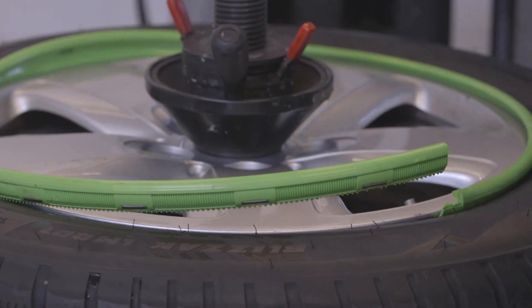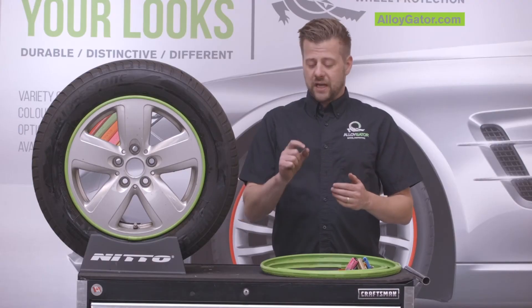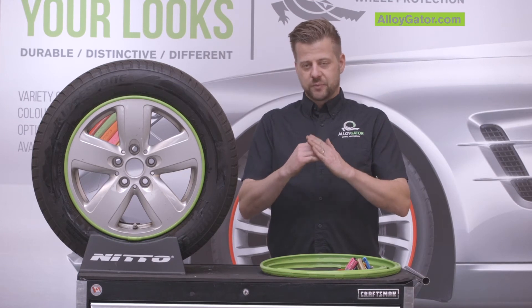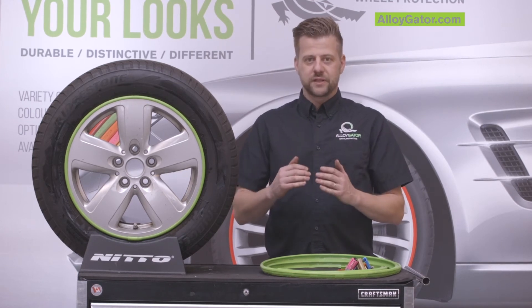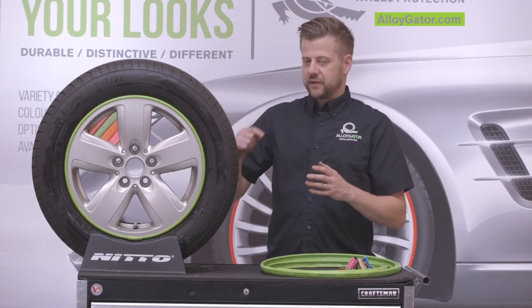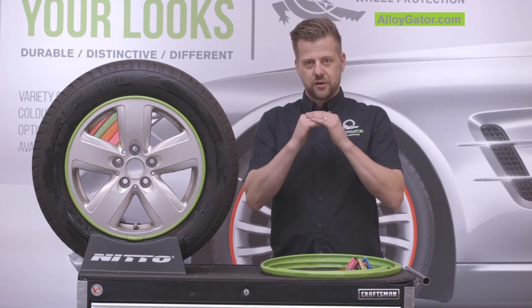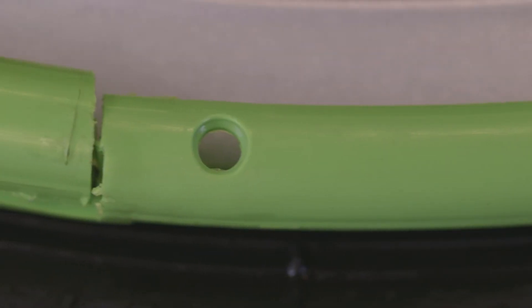Now you could have other reasons. The two ends could be perfectly fine and have a big enough gap, but the teeth are not lined up and they're sticking up, which prevents the gator from getting in between the wheel and the tire. Over time as you're driving, it pushes more pressure on it and pushes the gator away because those teeth are not lined up, which doesn't get it in far enough.